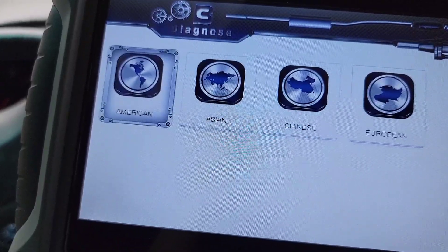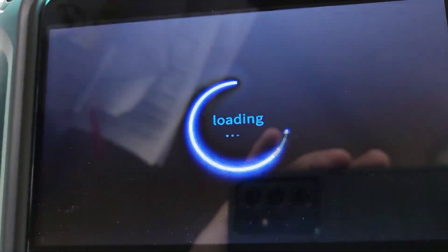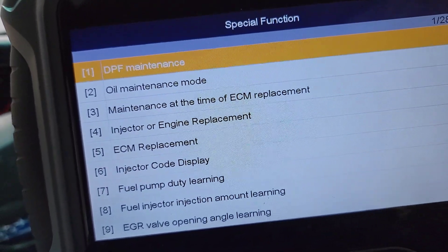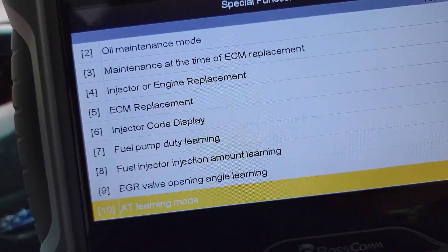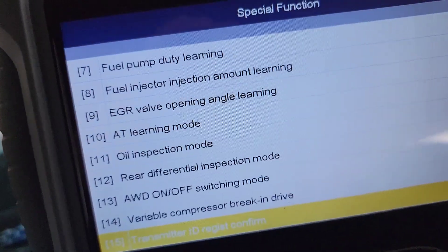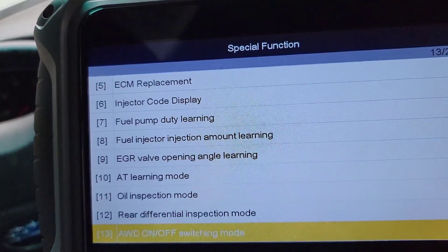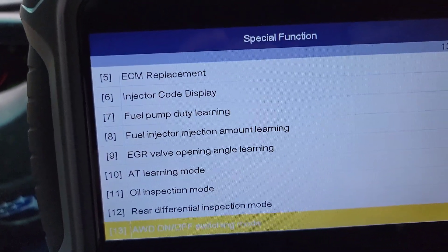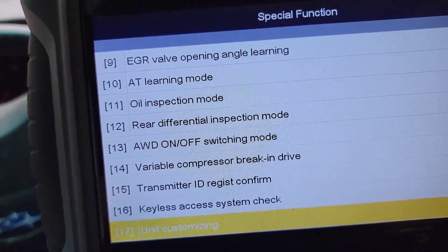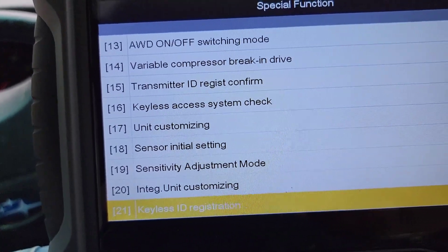I am in a Subaru, so we're going to go into Subaru and see. These are one of the deals I find to be harder to really get into some of the modules, especially an older one. You can see it has a listing — like most scan tools do — of things you can do with it. But does that mean it actually connects? Let's see if it connects to the ECU... and yeah, nothing. So some of these functions and modules it claims to have are obviously just dummy modules and they're not going to give you an actual ability to get into that system.